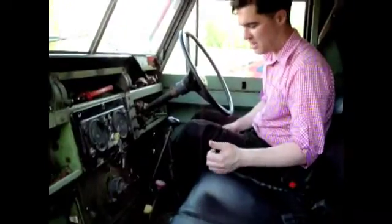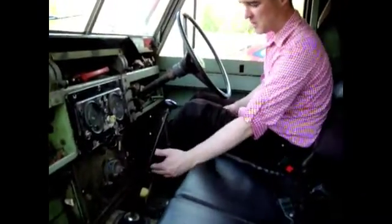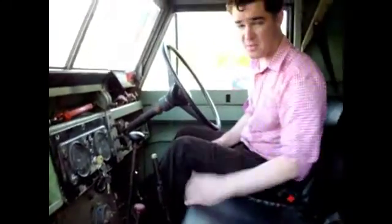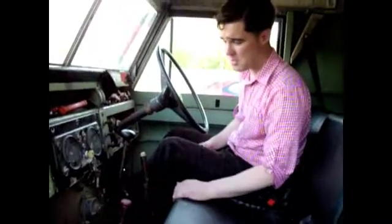Basically the reverse of engaging. What we'll do is drop the clutch, push the black lever back in, transfer box forward into high range, gearbox into neutral and your vehicle is ready to drive. So that's basically how we disengage it.